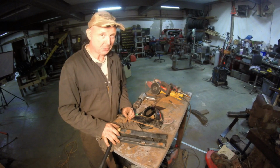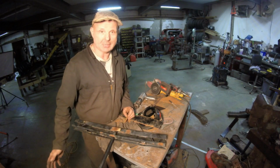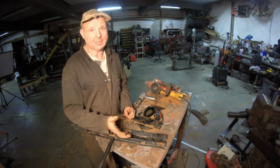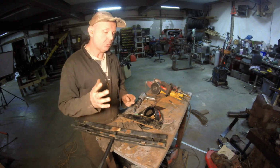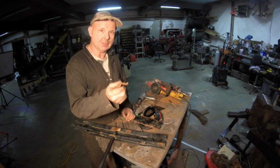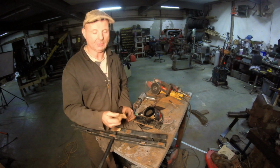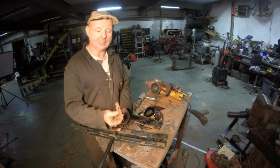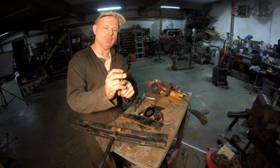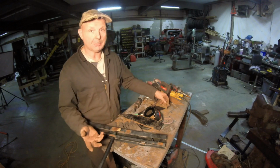All right, you're probably wondering what I'm gonna use for the inside of that headlamp, because we cut off the right side of it, where the fog light was, because we can't put that in, it was way too big. Well, have you ever seen one of these? This holds your battery down in a Volkswagen Audi vehicle, and for a lot of other cars. This portion sits on the battery box, a bolt goes through here and clamps down on the battery and it doesn't go anywhere. I'm doing the same thing. I'm just copying that idea.